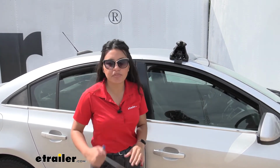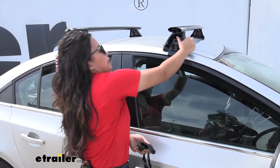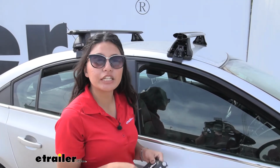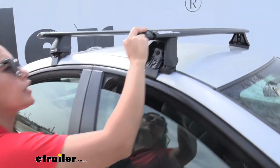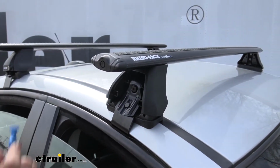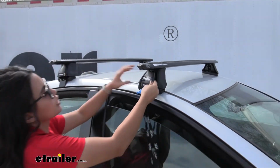Now do the exact same thing for your rear crossbars. Once you double check that all 4 towers are nice and secure, your hooks are tightened down to 4.5 Newton meters, then your final step is to put the end caps on. There's going to be an end cap for your crossbars that uses the Rhinorack blue tool. Then there's the end cap for your towers.